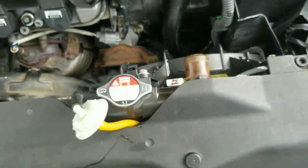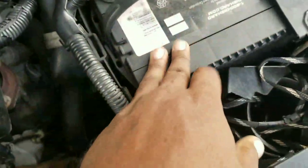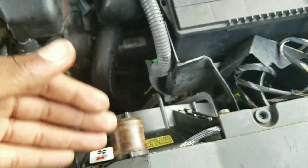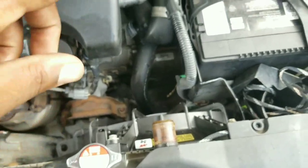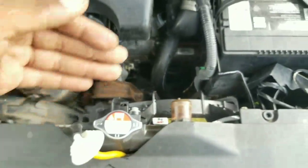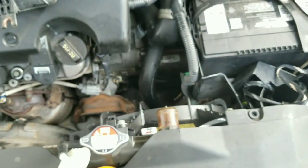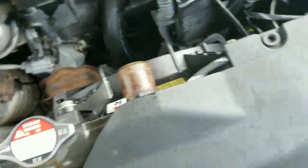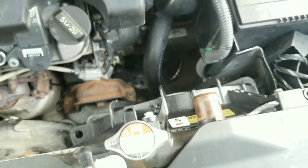Another way of testing it after you're done: since you took this hose off — some people take out the battery and battery tray, but the battery tray is a pain to take out — I just take the radiator hose off. Since there's a little air in the system, when you get in the car you let it warm up a little, then hold down the gas to about 2000 RPM and wait for the fan to cycle on and off two times — that's how you know you got all the air out the system. I usually take the cap off and let the coolant come out to let the air escape — you'll see the little bubbles come out the system.